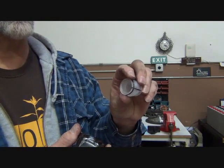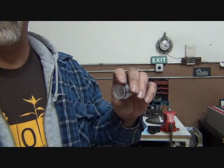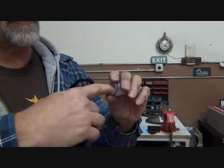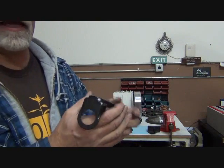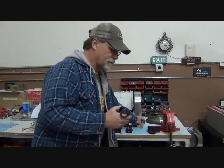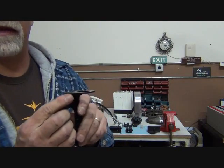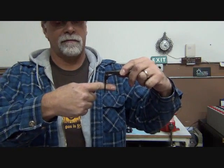You can see it's a real thin wall, and they've got a rod rubbing in here all the time, and there's pressure on it. It's being pushed. When you're rotating that rod, the way it does it, it's pushing forces outward on this, and they just don't hold up. So what happens then is, once you've worn through this, and this basically breaks in two, now all we have is our hanger. And this is just a thin piece of metal here. And that shift rod then is in here, all loosey-goosey.